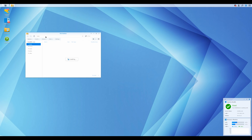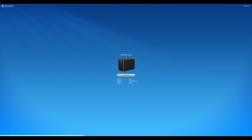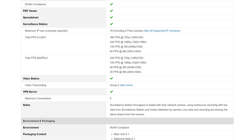Let's take a look at that OS. It acts just like a normal desktop operating system would, with an app launcher, a system tray, and window management — all within your web browser. When first hooking it up, you should be able to go to find.synology.com, create an account, and get set up with the software. From there you can configure everything: set up cloud services to sync with backup shares on the drive, manage users and file shares, get instructions for setting up network locations on your local computers, and even set up a malware service to continually run on the drive. The OS also lets you configure your server as a DLNA media streaming service to stream photos, videos, or music to your media player. Keep in mind this is not a media transcoding streaming server — it will just stream the original formats. It can also stream to iTunes for your music library, support up to 16 IP cameras, and 5 connections for a personal VPN.